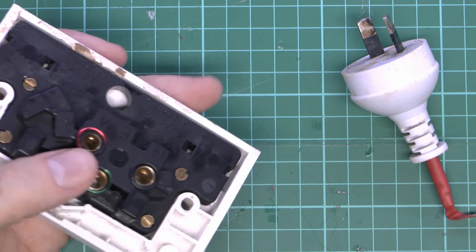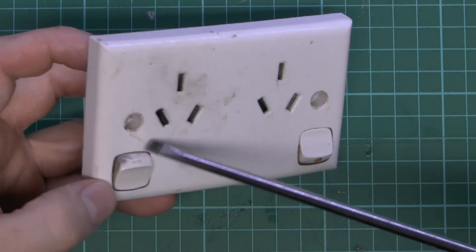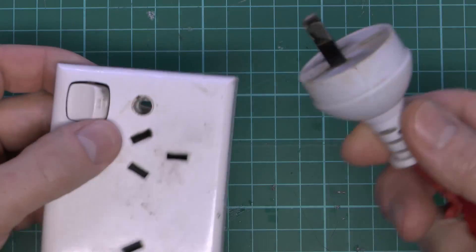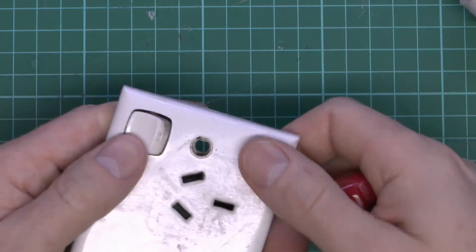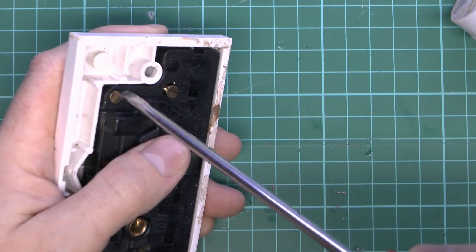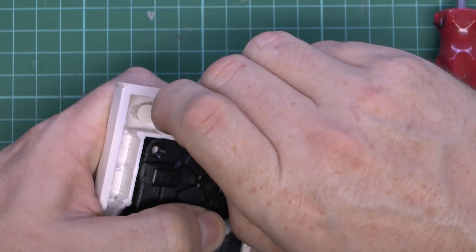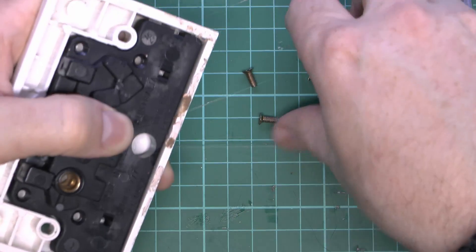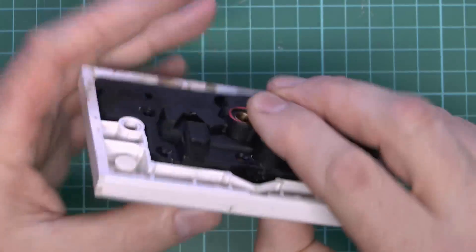So let's just see if we can open this up and take a look inside. You would expect the damage to be on this side, because that's where the blackened switch is. And even though this was pulled out without it being turned off, that should be perfectly fine, because the method of disconnecting of course is just to remove the plug — and of course not all outlets even have switches anyhow. This particular one does seem to be reasonably easy to get into; a lot of the ones over here unfortunately are welded shut permanently, or riveted.